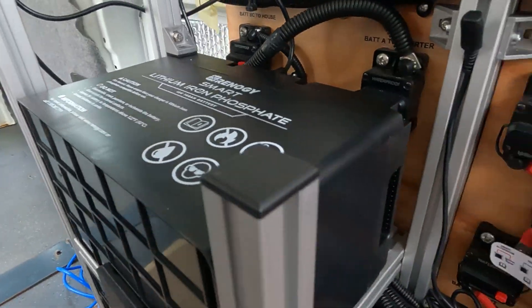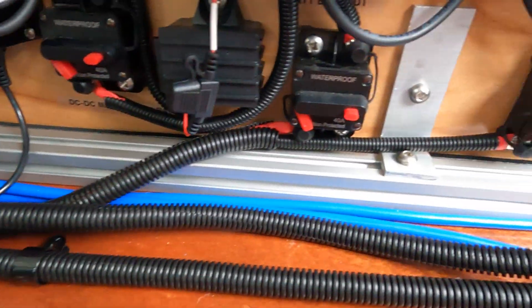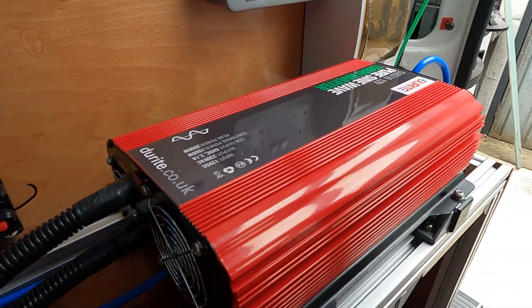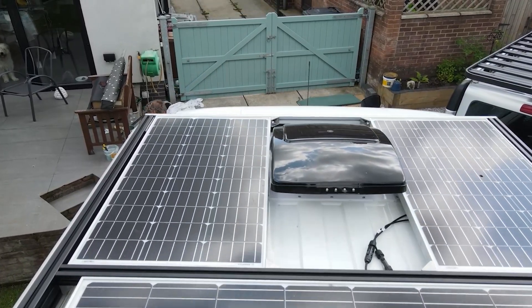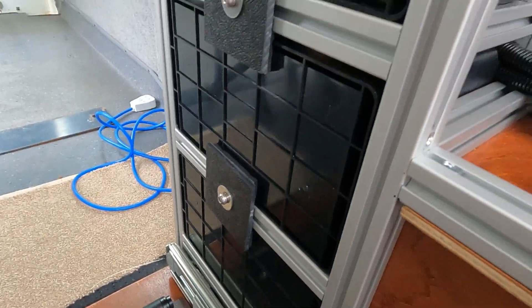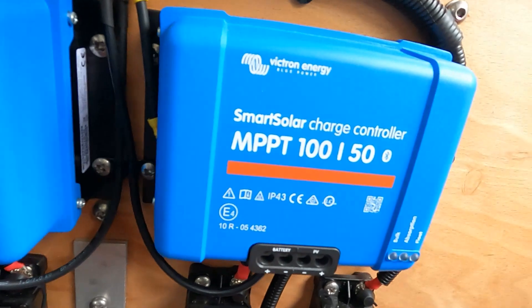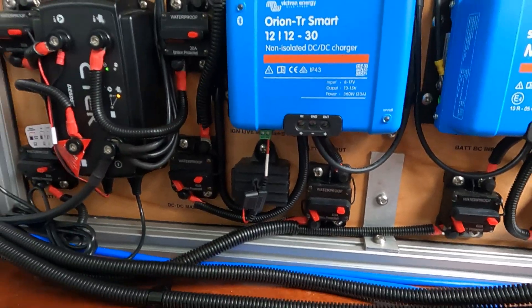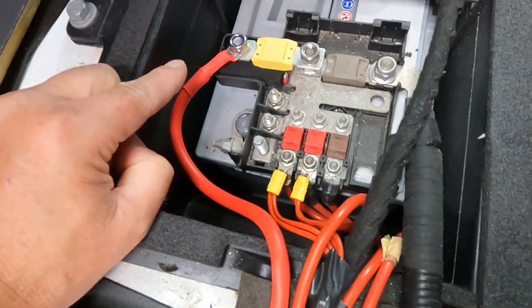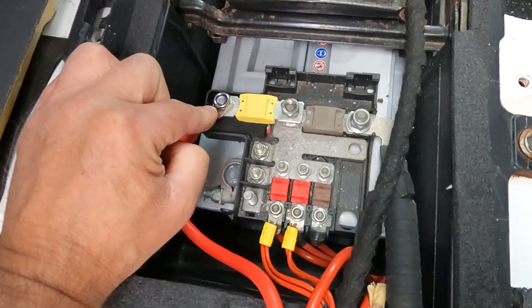I now have my three Renogy batteries installed. This one battery supplies power to my inverter, which I'm going to be using to charge my mountain bikes and supply 240-volt power to the rest of the van. It draws its charge from the C-Tech unit, which in turn draws its power from the DC to DC port I found in the B pillar and also from my two solar cells in the front of the van, which are 160 watts between them. My other two batteries supply my house power — they're charged via two Victron units: one MPPT charger which draws power from the two larger solar cells on my roof, while the DC to DC charger draws power from the battery installed in the front of the van.